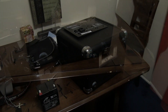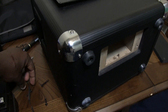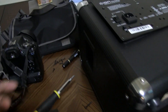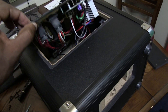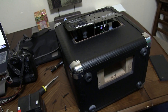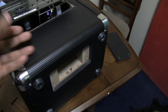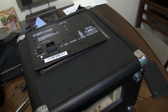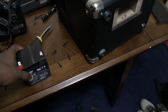To recap: unscrew the four screws — they're different lengths, so keep them separated so you know how to put them back in. Then unscrew all the screws from around the panel, take something sharp to pry it open, lift it up with your hand, and make sure you don't put too much force on the wires. Don't touch the electronics because static from your body can damage them — that's why I always keep a static wrist wrap when working on something like this.